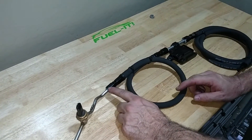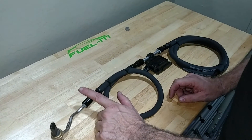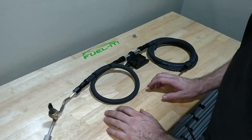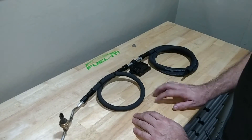To make this a little easier, it is better if you put a little bit of grease on the end of each of these fittings — it will help them seat and insert into the fitting a little better. That is the overview of our new ES1 Fuel It fuel line upgrade with the integrated ethanol sensor. Thanks for watching.